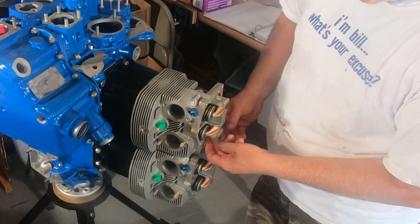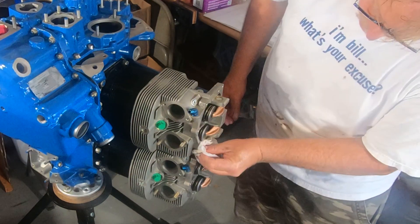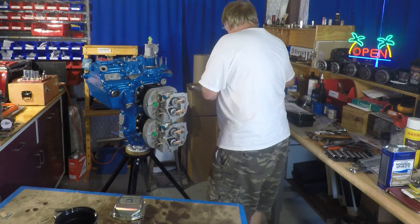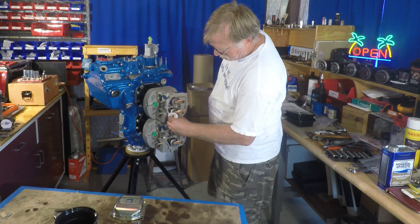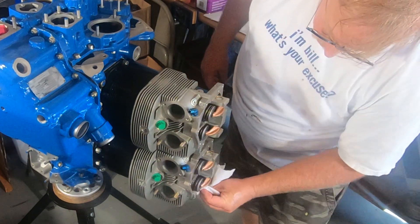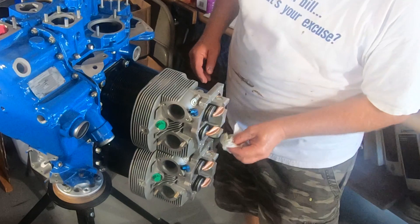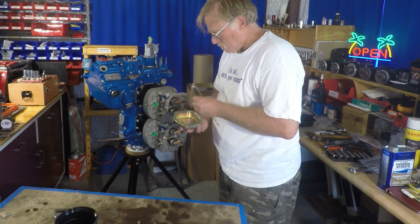Once that's done, it's pretty much just valve covers. Unlike Continentals, Lycoming uses plastic buttons on either end of the rocker shaft — we're installing those. All brand new buttons come in your overhaul gasket set. We're degreasing the valve cover area, making sure there's no dirt, oil, or residue. These will go on dry, which is fine — the engine can run that way. We don't know if the owner's going to eventually put silicone gaskets on, so these may be changed, but they'll be fine going on dry and will not leak.